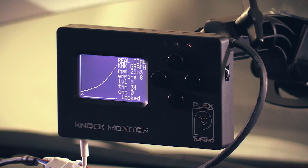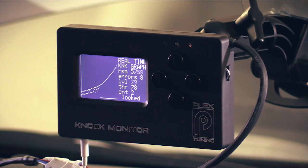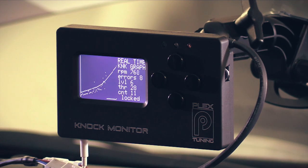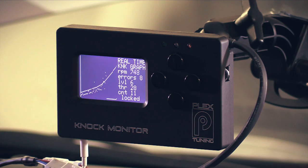Now I'm going to add some timing back into the engine and do a run on the dyno looking at our knock threshold table view so we can see what happens when we invoke some light detonation. On that run we've had a few little points where that knock noise level has exceeded our knock threshold, and we've got a knock count of 11 — so it's picked up 11 knock events during that run. During the run you can see it flashes a warning light to indicate that detonation is occurring, which is an indicator for the tuner to back off and stop.